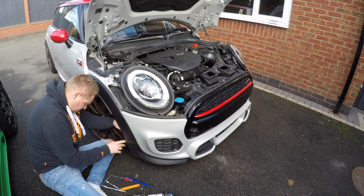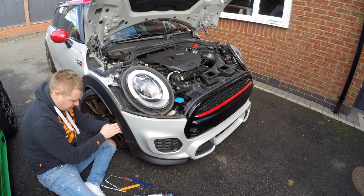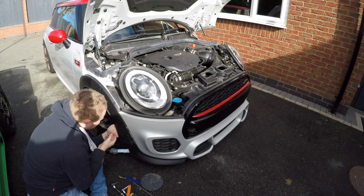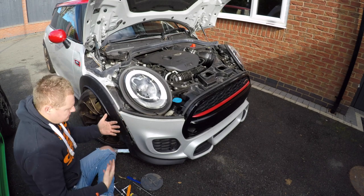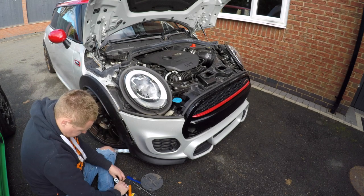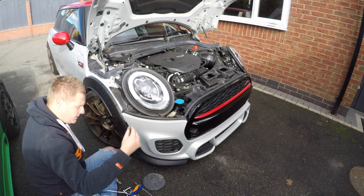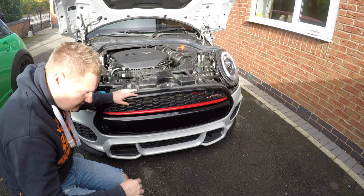Removing that bolt gives us the ability to flex the inner wheel arch so we can then start working on the little clips behind here. I always try to be a bit more careful coming to the wheel arch, spreading the load with your fingers so you're not pushing in one place. There's a video on my channel how to do this in detail. Okay, that's the second bolt out. Under the car there are three bolts - one there, one there, and one there - so we're going to get underneath and remove those.